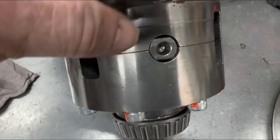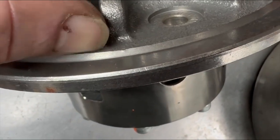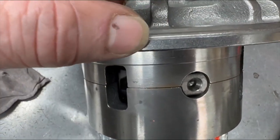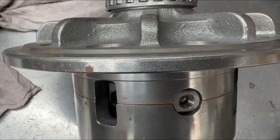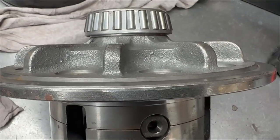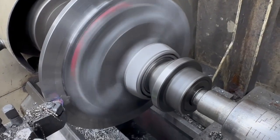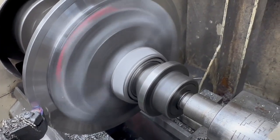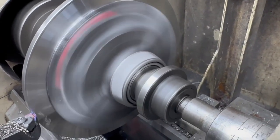So if you machine this away, you're weakening what is already a weak crown wheel and then putting a pad back on it — you're sort of not gaining anything. What we do is machine this ridge away back to there. This gives us a nice big flat area. We've still got this great big thick lump supporting the back of the crown wheel, and then we add our peg pad to the back of it, which really does improve the strength of that combination. We've got multiple diffs showing you how this lot goes together.